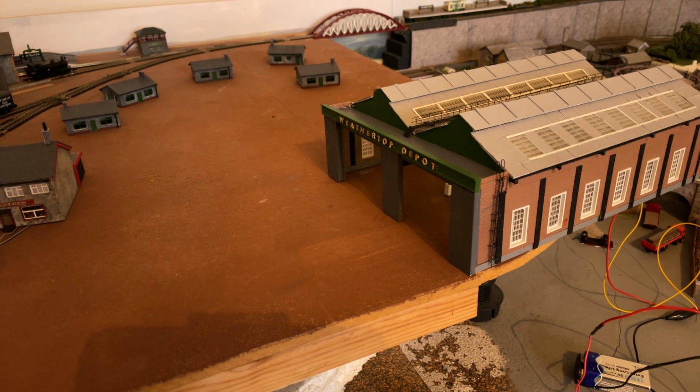And then once I'd finished and was standing back to enjoy this piece of work, the lights stopped working. And the black wire that was coming out of that was powering the lights on the left-hand side, the joint that you may recall I had problems with before, had obviously decided to start playing me up again. So some emergency repairs, in fact, have only just been finished. And a yellow wire was fed up and soldered in place, and that's working fine now, thank goodness.